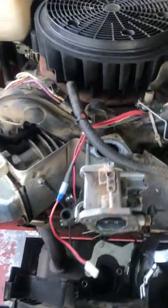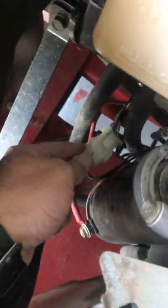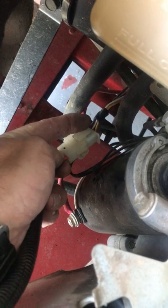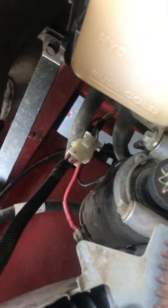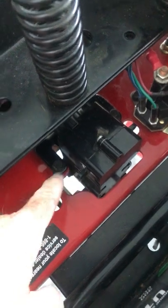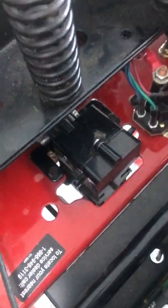I continued tracing the wires — traced the red wires back from this plug, through the wire loom, down through this first connector here. I had continuity both ways. This red wire, after it goes through the plug, becomes a yellow wire. I traced the yellow wire all the way around underneath the machine and it goes into the back of what I think is the parking brake mechanism, because when you move the levers out it applies the brake so the mower won't start.